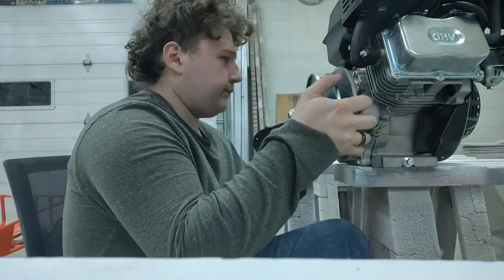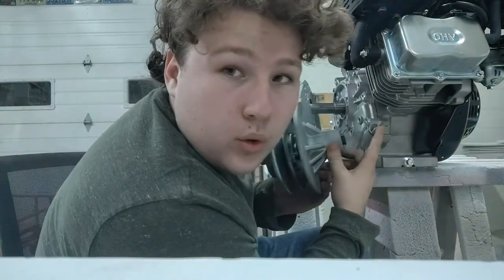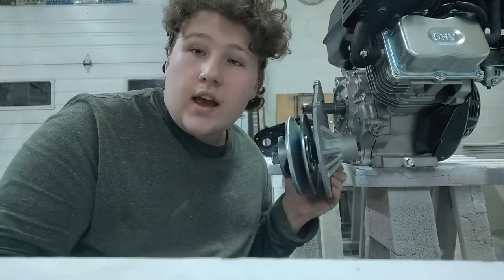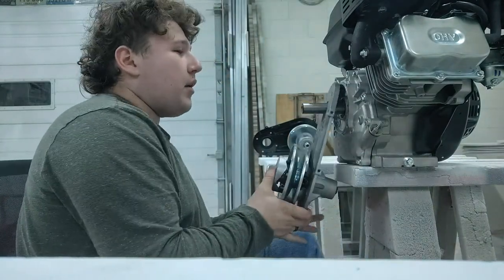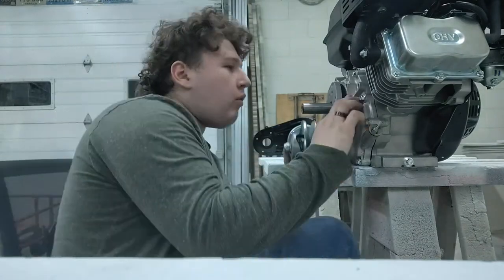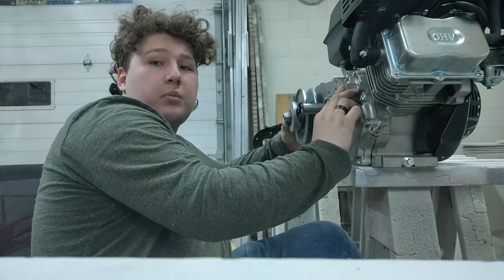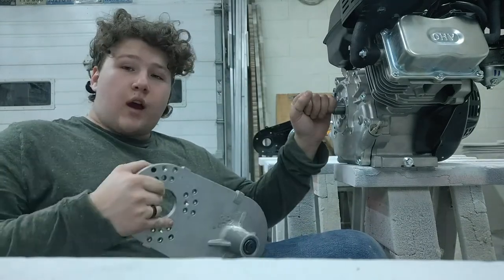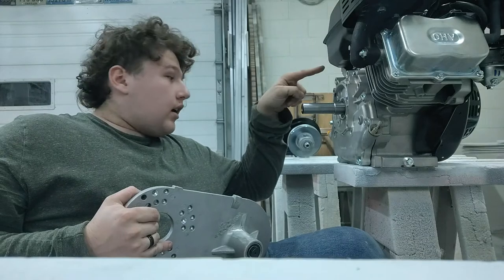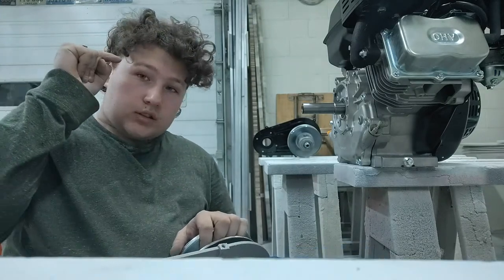It's hitting right here, hitting this oil flow area down here. You're going to have to bolt that off, cut this off, or make modifications — a whole bunch of things you don't want to do. If you put it lower it'll hit your engine and you get dirt and water in. If you put it where it originally was you'd be running backwards and your chain would be longer than it needs to be. You could run this but it would be too much power for this torque converter — the stock governor will not engage with a 40 series torque converter on a 301.